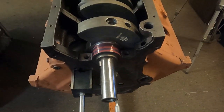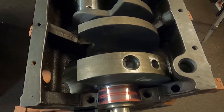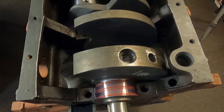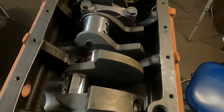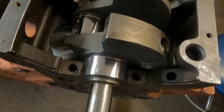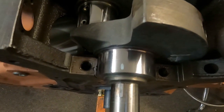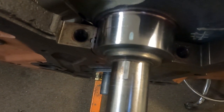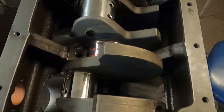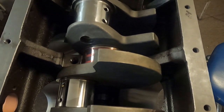If you were to get over 14 thousandths or so, it's probably not going to hurt you but that would be a little excessive — though plenty of engines have run there. This is a completely stock 312 build, so we're just going to use a plastigauge, which specs out right at about 2 thousandths when you compare it to their chart. On a good street build like this, 2 thousandths clearance on the mains is no problem.